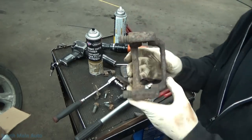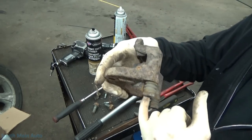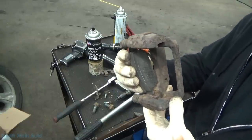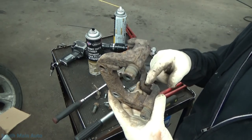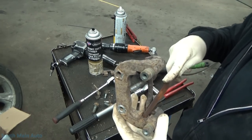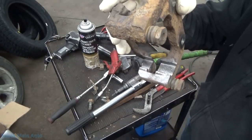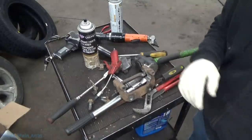The biggest part here — and this is not going to apply if you live in the sunny state of Florida or anywhere south of Pennsylvania — is the caliper brackets. As you've seen in multiple other videos, they rust completely here where it holds the pad. When the hardware is on there, the rust gets behind it, starts squeezing the hardware, therefore locking the pad up and causing the issues. The rust has to be removed. You can use a file and get it all scraped out — it's going to take you a while. Don't use a wire brush, because all that's going to do is shine up the rust. You've got to get it back to bare metal. I'm going to use the sand blaster.